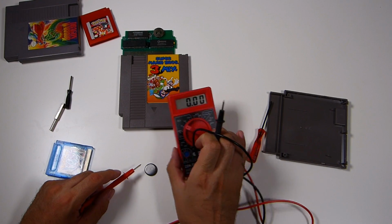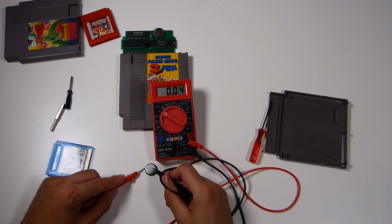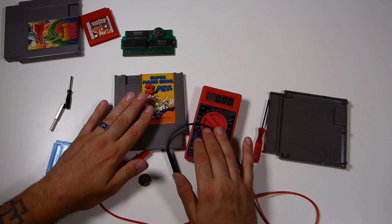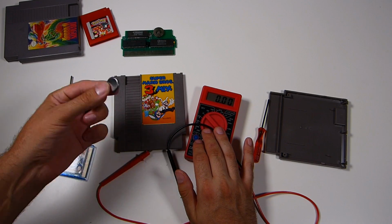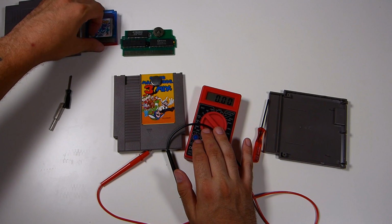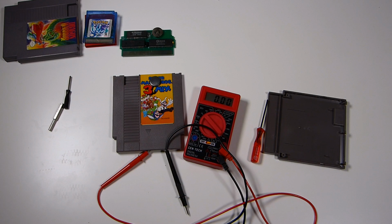If it was still at 3 volts or 2.8 volts, she probably should still be good. A lot of people out there will tell you that typically the batteries can still be good down to 2 volts. It's too risky, in my opinion. Way too risky to keep your battery at 2 volts if it's sitting at that. 3 volts is what you want it to be at optimally. To have a brand new nice battery, it needs to be above 3 volts.